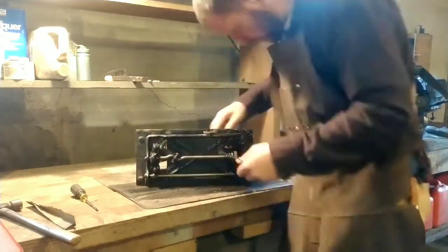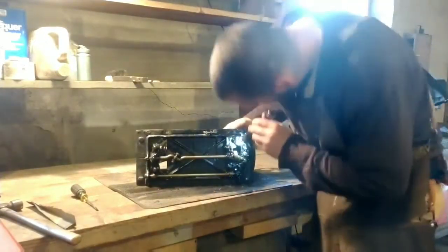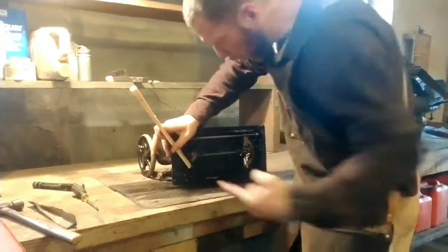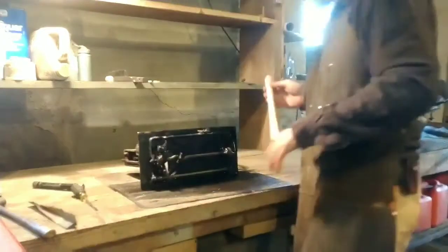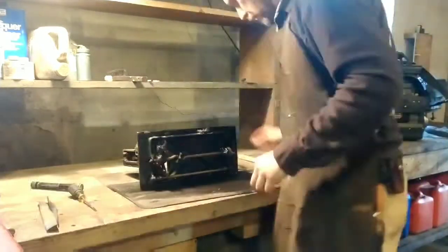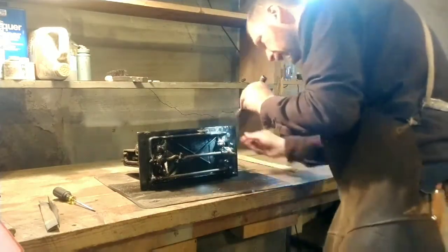Just try it a little bit at a time. There are two screws on that heart-shaped cam and the larger one in the center will pull that whole disc right out. If it's really corroded and bad, you can just pull that whole assembly out and work on it separately - which is what I ended up doing. Rather than leaving the bench, I just turned my attention to other parts of the machine and I'm tapping again here.